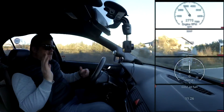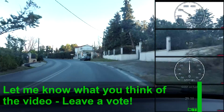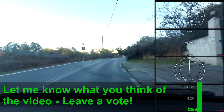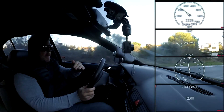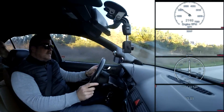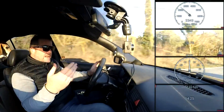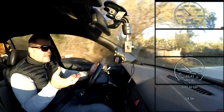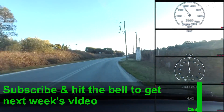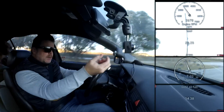It's making that noise because the throttle pedal is closed and the turbo is still turning, still trying to push air into the engine even though the throttle pedal is closed. So that air is then coming back down the intake track back towards the turbo. You've got air backing up in front of the turbo which is potentially slowing it down between gear changes.